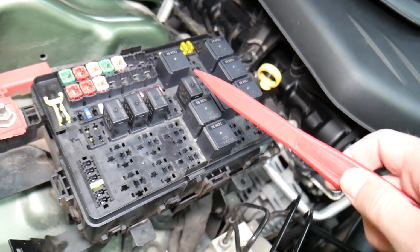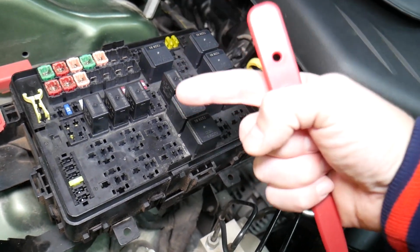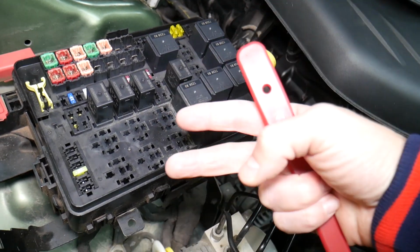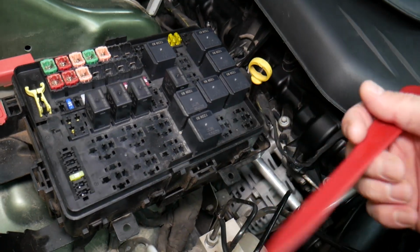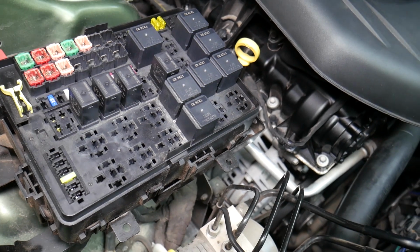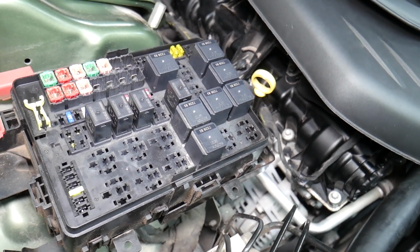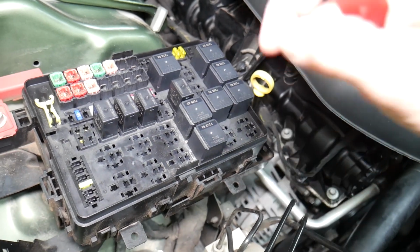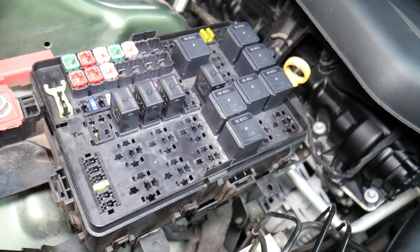But when disconnecting the car battery, another common mistake people make is not knowing which battery terminal to reconnect first. If you do it the wrong way, you can burn electronics modules. How do we know about that? We burned a traction control module on a BMW before that cost us $2,000. So we'll put a link in the description of the video below on which battery terminal to disconnect first. Check it out for your convenience.